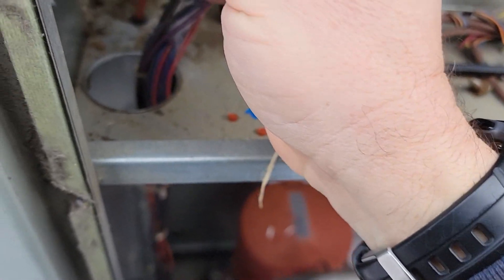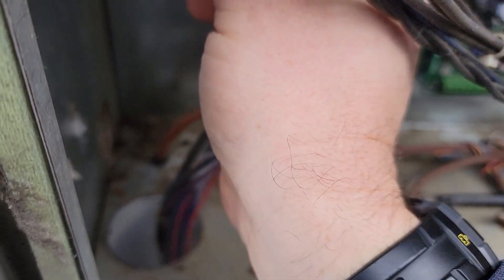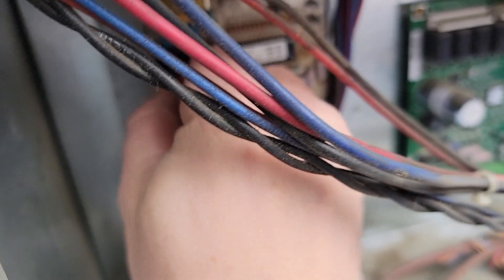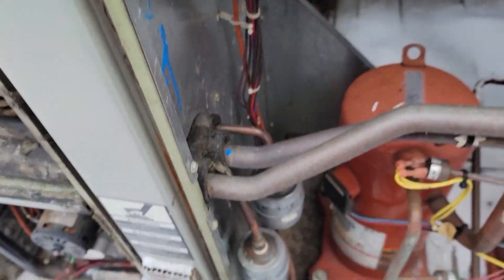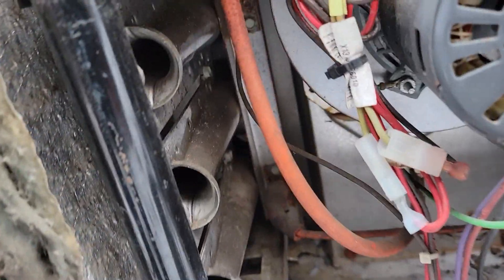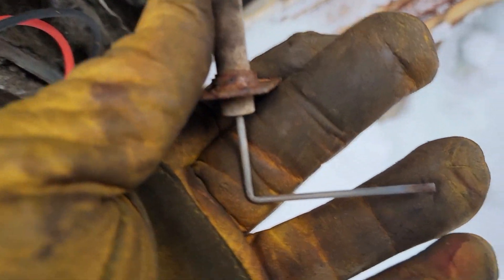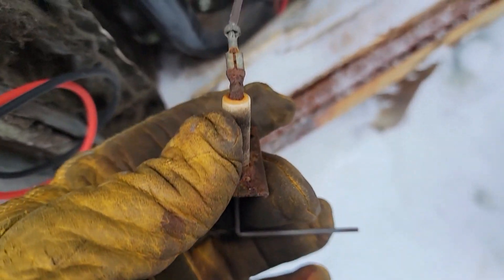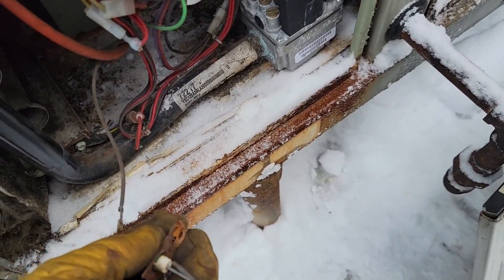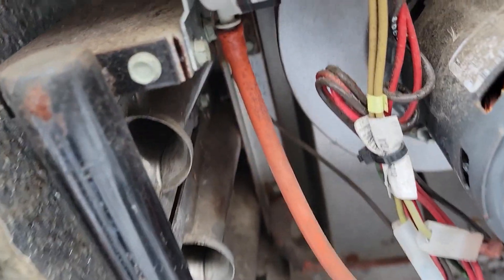Got a little more than needed there — you gotta be careful when you shove it on so you don't just jam it back, which is probably what happened. I've seen people strip it out and bend it over the rubber, but generally if you wiggle it you can get it to slide past onto the cable. Make sure it's not shorting to ground anywhere. There's the flame sensor — it looks like crap. Let's go ahead and clean that real quick. It wasn't the easiest thing to get off. It's a little dirty — clean that up. When you let snow into your burner area it tends to happen. Probably has something to do with that panel piece they're missing. I like my stainless steel brush — it's good at not leaving marks. Got it back in there.